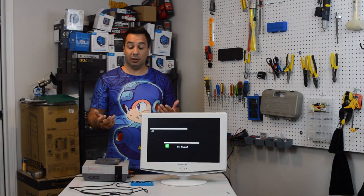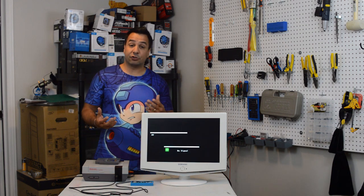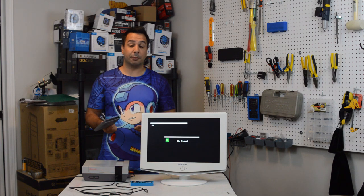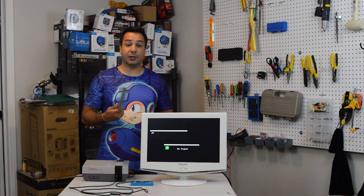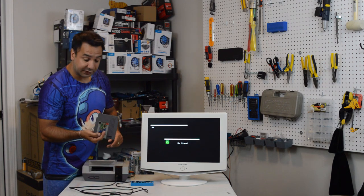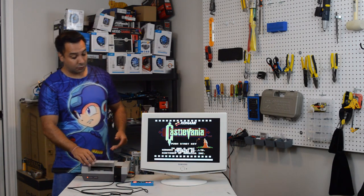Now that the pin has been boiled, I've reassembled the Nintendo and we're going to test it out and see if we got our problem fixed. Just as a quick reminder of what we did: for the power problem, it was actually not a power problem — it was the power supply that was damaged. So keep that in mind: whenever your Nintendo stops lighting up, before assuming the Nintendo itself has a problem, try picking up a spare power supply and testing that first. If you pick one up from Amazon, it's less than ten bucks, and if it ends up not being your problem you can always return it. So here we have our test system set up, the Nintendo is plugged in — we're going to pop in our classic Castlevania. And there we go, guys — we have our Nintendo back in working order.